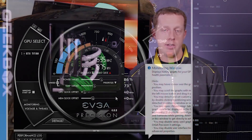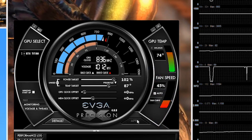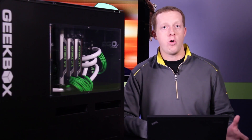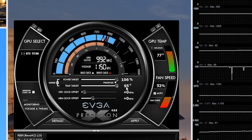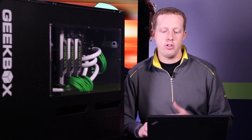That's adjustable now in the latest versions of applications — we're going to show EVGA Precision X because that's the one given to us to demo. According to Nvidia, this allows you to run at higher clock speeds on average than the previous version of GPU Boost. When you get into overclocking, which is supported on Titan more so than even the GTX 680 or 690, you can now adjust the voltage and move something called the temperature target. You can still move the power target, but now the temperature target lets you say you're comfortable with 90°C on the GPU, and clock speeds will adjust accordingly.